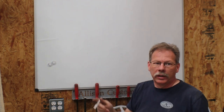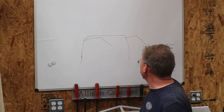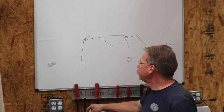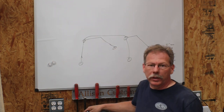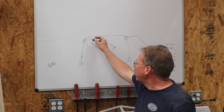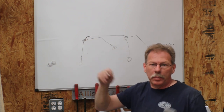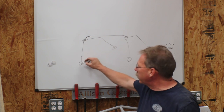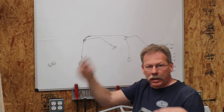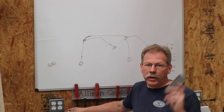We're not doing a full cage - I think four points. We're going to do a main hoop, come off of it with a couple of down bars that will reach behind the rear wheel wells. We're going to weld this joint, this joint, this joint, and this joint - and back here as well. We'll weld those to some floor plates and the plates will be welded to the floor. Now we essentially have a convertible - we can take the top off this truck, so wherever this point ends up in the corner I can weld 360 degrees around it because I can take the top off and get to it.